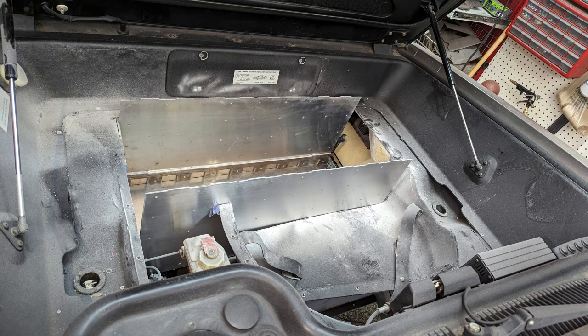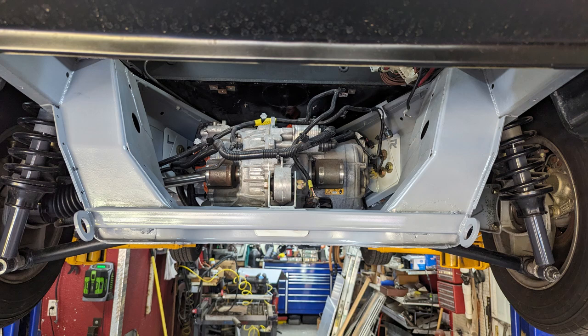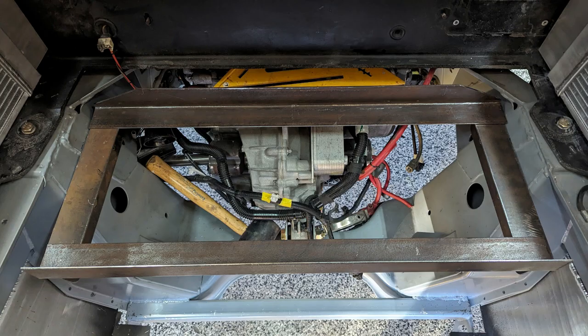In the rear of the car, it used to have the engine and transaxle, and now that's wide open. It's the perfect amount of room for the remaining 12 battery modules to complete the 100-kilowatt-hour battery pack. This area is wide open, yet it lacks structure to support the battery boxes, so we need to start making some strong mounts for these boxes, starting with the upper box.